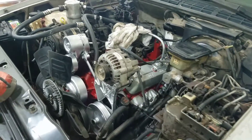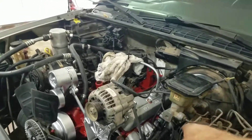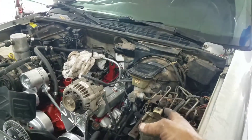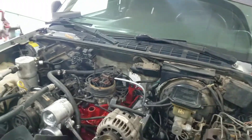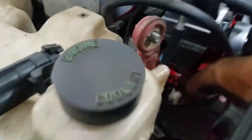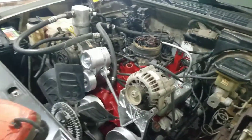All right, catch up on where I got to today on this thing. I haven't really been keeping up with what I was doing. I've been working on the exhaust. I got the exhaust done underneath there, got everything hooked up, got the starter on, starter wires hooked up. Got the oil pan, the oil filter on, changed the plugs and everything, got the plug wires and caps back on — everything is hooked up as far as I can tell. Got all my braces on here — the ones down underneath I gotta tighten up. That one side right there, and I gotta tighten the one bolt up over here for these braces that run down. It's a brace that runs from here down to the dust cover, and I got one on the driver's side as well.